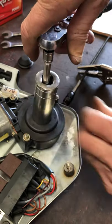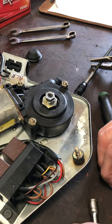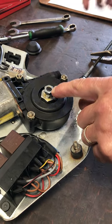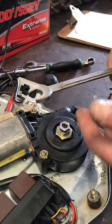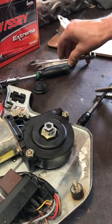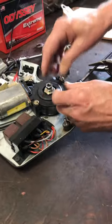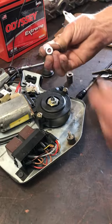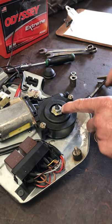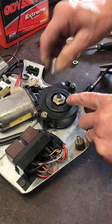You can set your clutch just like that going through it — you've got to hold that 22. To make it easier, find a way however you can to get that 13 millimeter lock nut off the top. You can grind another cheap wrench to make it thinner because it's tough to get two wrenches on there. Use needle nose, whatever you need to do to get that top 13 lock nut loose. Then it's easier — instead of trying to line up the socket on both nuts, just remove the top nut altogether. Do not forget to put Loctite — a semi-permanent threadlock or blue Loctite — on there when you put it back in.